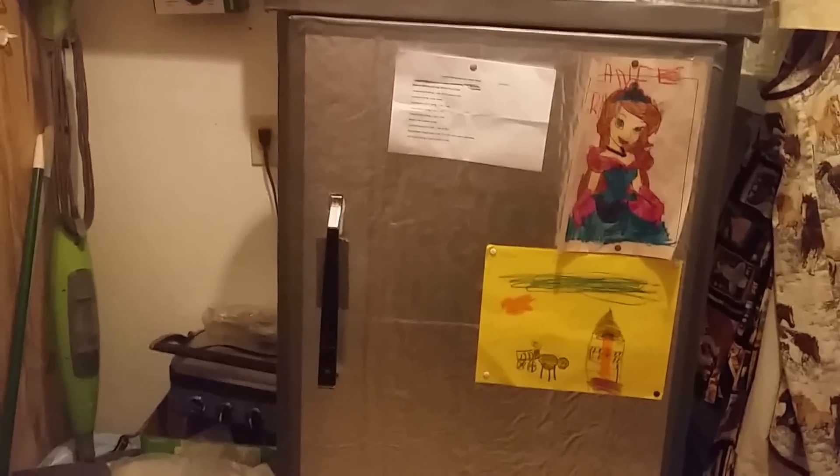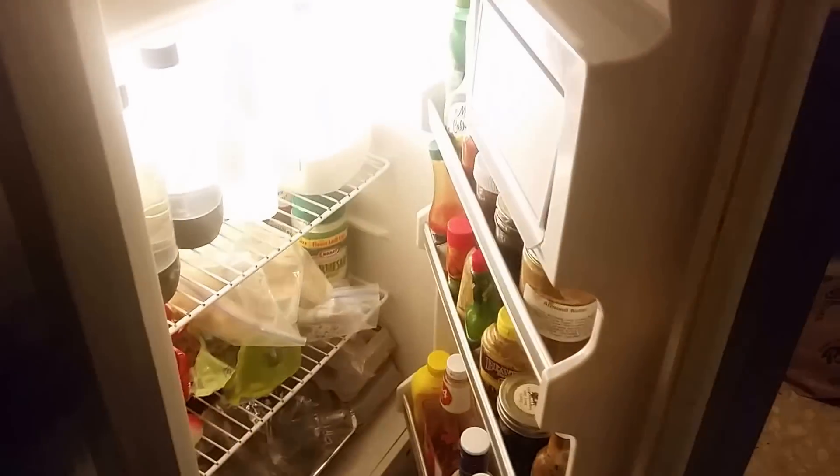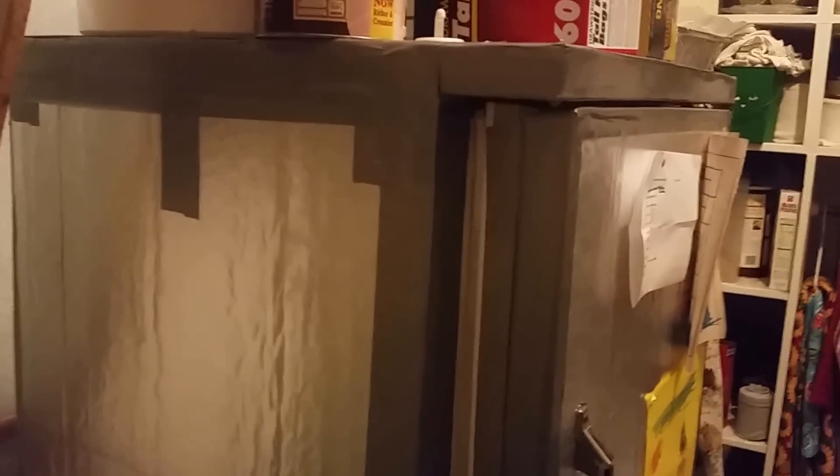What we're currently running is an upright refrigerator, and yes, when you open the door all the cold falls out the bottom. But this one has no defrost cycle, so it isn't expensive to run. The thing that makes upright refrigerators use so much power is they have a defrost cycle on both the refrigerator side and the freezer side. This one doesn't have that — you have to manually defrost it.